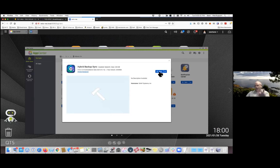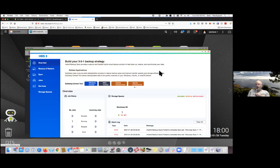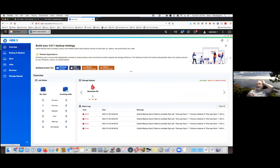And I found, at least with my current network, that the transfer speeds were much faster, especially now that USB 3 has come out. Under USB 2, it wasn't, but now I do have a 1 gig network, but as I understand the way Ethernet works, the speed of your entire network is limited to the speed of your slowest component on the network at the time that you're doing things. So I have Cat 5e cable in the walls of the house, so that's capable of a gig. But I don't have gigabit adapters in everything that I've got. I've replaced my switches because I have a 12 port switch that's now a gigabit. But I don't think that I can transfer at 1 gigabit across my Ethernet network. I haven't ever tested it.